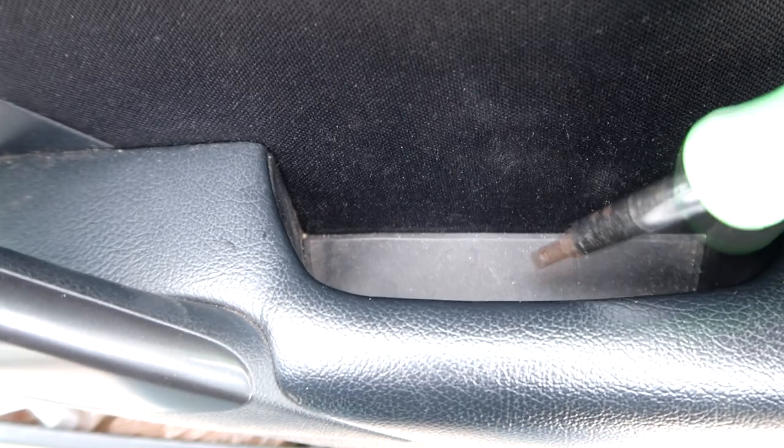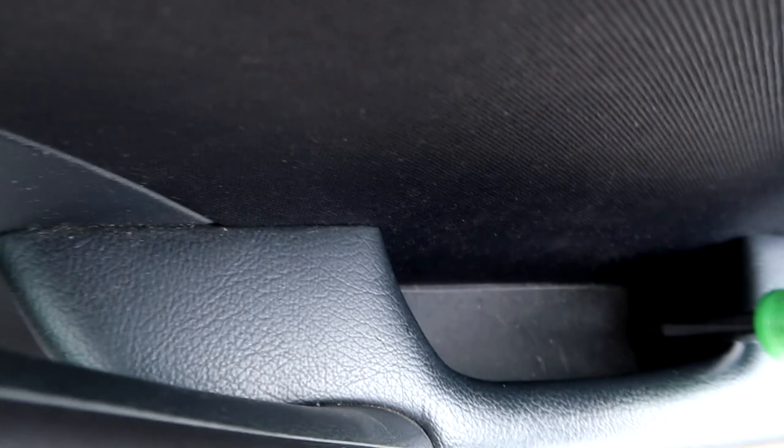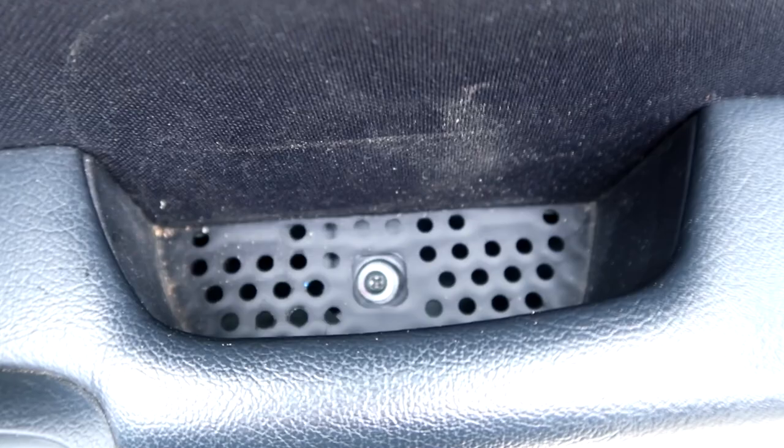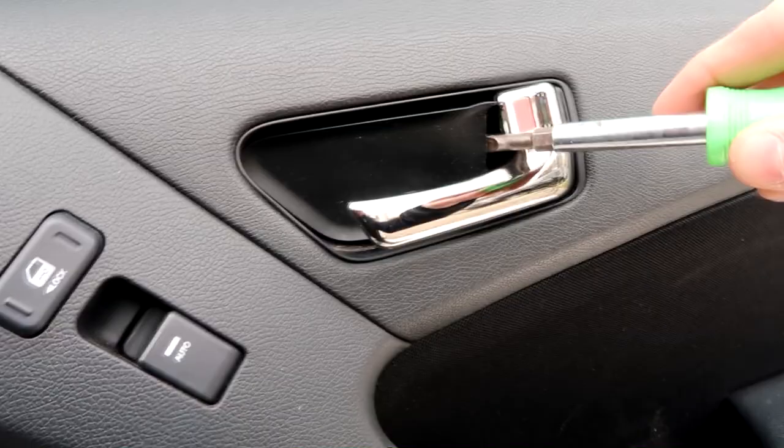In order to find the bolts, there's a little rubber piece here — you kind of have to just wedge it up, just like that. See how the piece just came up? So that comes out, and then there's a bolt right down there with a Phillips screw on it. And then there's another piece right back here, which has to just pop right out the same way. And then you've got another screw right here. So you want to go ahead and take both of these guys out. And then you have to go all along the door and just start pulling it out.